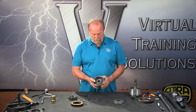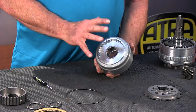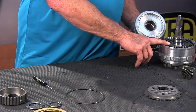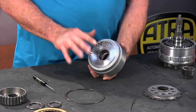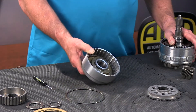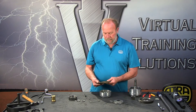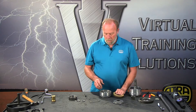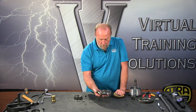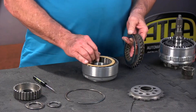We're back from the foot press with our snap ring in. One thing I want to mention: after it's all cleaned up, you want to check these splines — these splines go into the sprag. Always look for sealing ring wear; we'll talk about sealing ring wear on the other unit in just a second. Now we're going to install the clutches and check clutch clearance. To do that, we're going to leave out the hub and install the pressure plate, then check clutch clearance. We'll get these clutches installed.